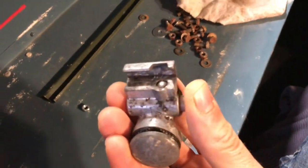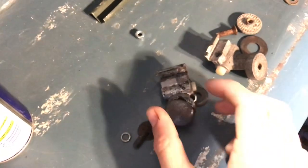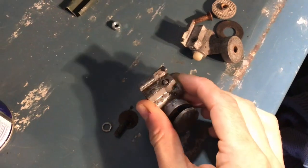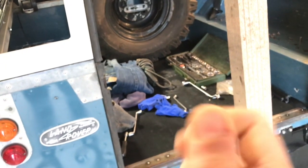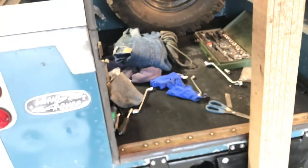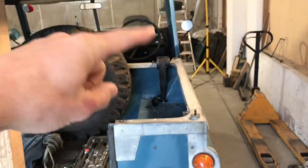I've got a solution I'm going to try. These are the catches which go in here, and they're quite rare. If you ever find them on eBay they're quite expensive. More often than not they're missing that small ball bearing in there - this one's seized at the moment. That acts as the little locking mechanism on the runner that goes along the top of the window. A couple of mine are missing, so I'm planning to machine down one of those little IKEA pegs - the ones used in all their cheap shelving - and see if I can make one up. If that works, I'll do it for the missing ones on this side.